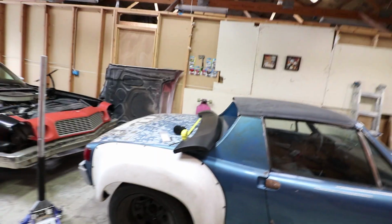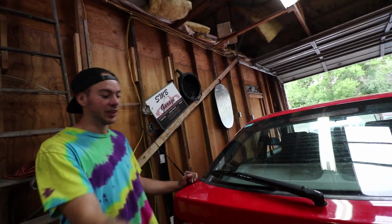Okay. We just measured how far out it's gotta go for the stands because it's got bolt holes in the wing. We're 16.5 inches out on both sides. Luckily, this windshield wiper, for you TI owners wanting to have a wing, is dead center in from the trunk deck lid.